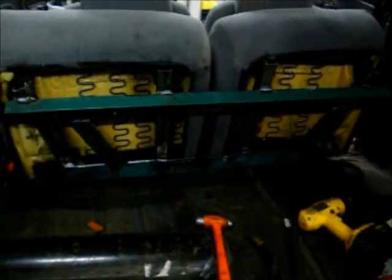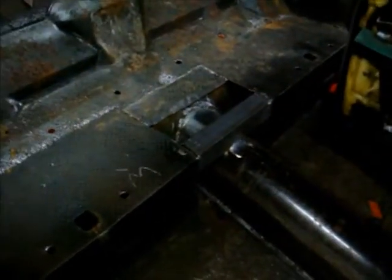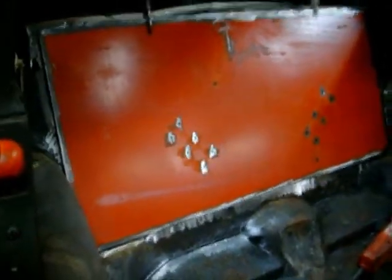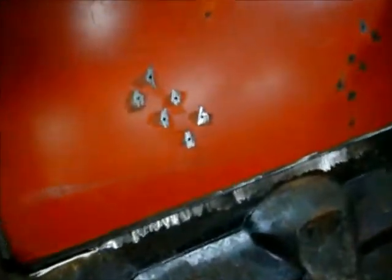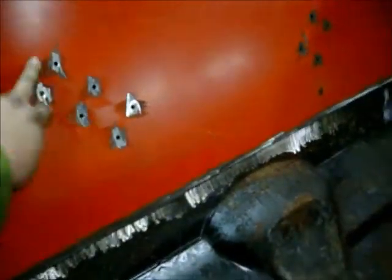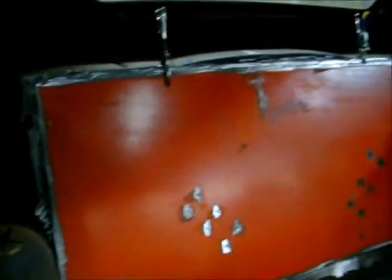The seat frame is made up for the rear seat — it's not pretty but it's functional, and bolts on right back here. Got the big holes drilled — it kind of lines up. Added another piece of angle iron right there to bridge that gap. I had to cut that out when I made the tunnel, so I put that back. Now for that big hole — that's next. Got the rear plate cut, everything ground up, and holes drilled here. A plug weld where the angle brace came through on the original Buick. There's a little bit of a ridge that sticks out here — that brace will catch and bridge both sides everything where I want it, so now it's a matter of welding it in.